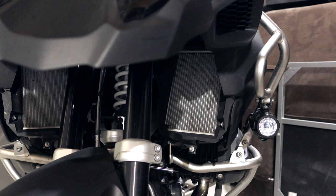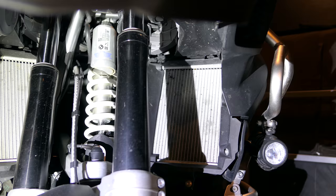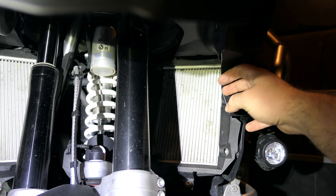I'm going to get some lighting here to help you guys see a bit better. So we're under the bike. There are three T25 bolts: there's one here in the bottom, one here, and then one behind this little flange fairing here. We're going to unhook all those and then we'll go to the next step.